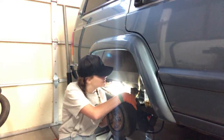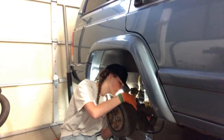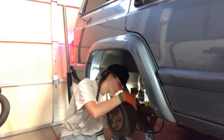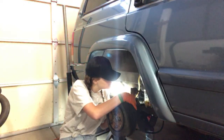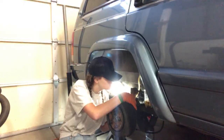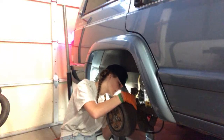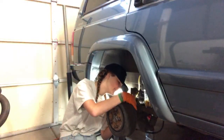Okay, close. Closed. I can see a lot of bubbles. There's a lot of bubbles that time. Have the bubbles stopped or they're still coming? They're still coming. Okay, we should do a few more then. Ready? Yep, tell me when to push. Push. Okay, close. There's still a lot of bubbles. She's saying we're still getting bubbles, so we're going to keep bleeding. Tell me when to push. Okay, push. Okay, close. I can feel every time you push. She said she can feel every time I push. All right, let me know when. Okay, ready? Yep. Push.